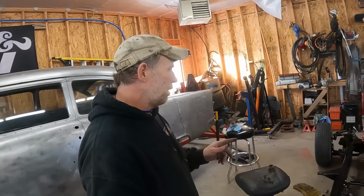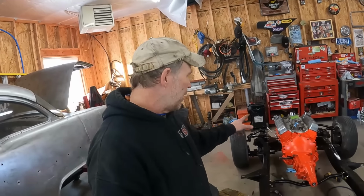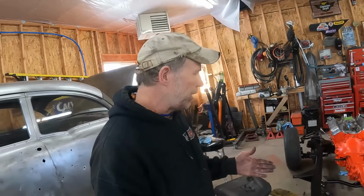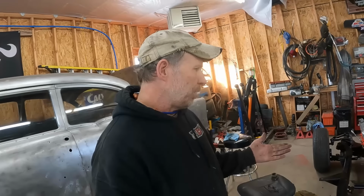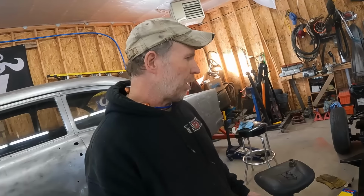In the next video, I'll probably be trying to fit my steering box back in, and then maybe seeing if my headers still fit. They may be a casualty of the 3/4 forward thing as well. Also, with the car being a little lower, I won't know this till I get some more weight on with the body and everything, but with the car being lower and the full length headers, they may be too close to the ground, I've heard. So I may have to go to a shorty type header.